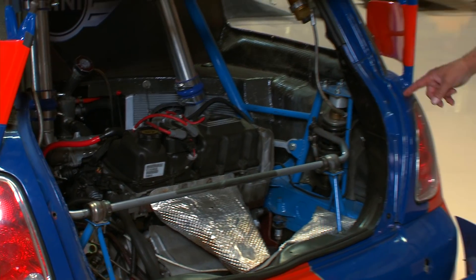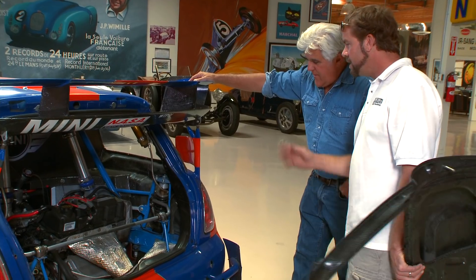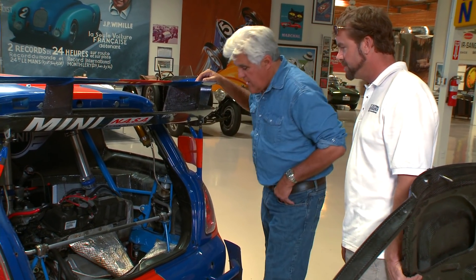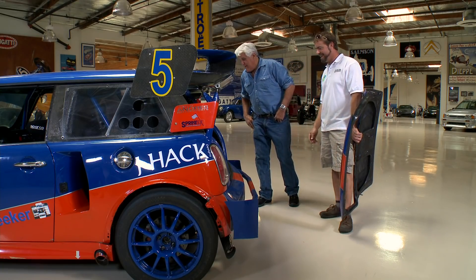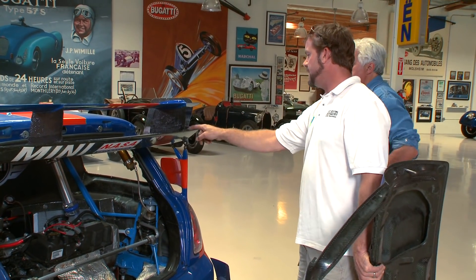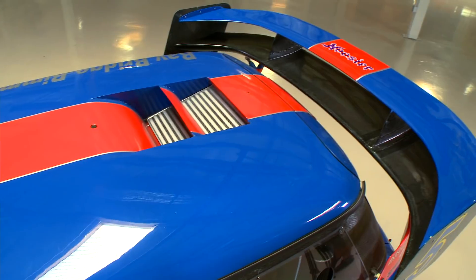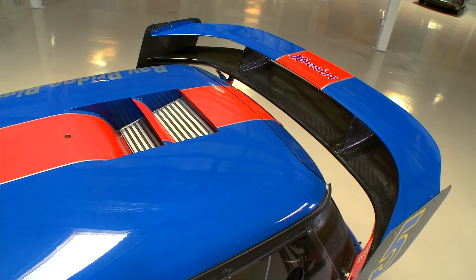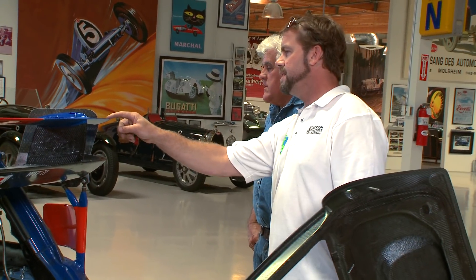What do we have here? This is a homemade sway bar — I didn't have enough room with the exhaust routing there, so I had to put the sway bar somewhere. A lot of times I don't like sway bars on the back of the car. I have a piece of tape over there covering some of my hack welding — I sometimes get the nickname 'J Hack.' It's nicely done. And this wing — I found it out of the bend of a very prominent Porsche team that won Daytona and Le Mans. It's called a banana wing, from the early days of the banana wing. And I handmade this upper wing element — shaping your own glider-style wing to fit the car was actually a lot of fun.